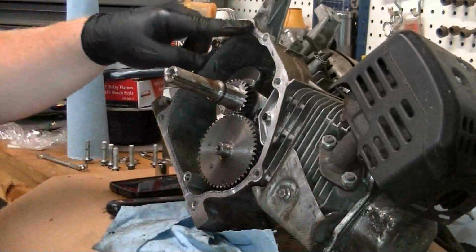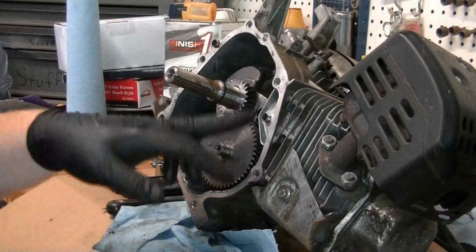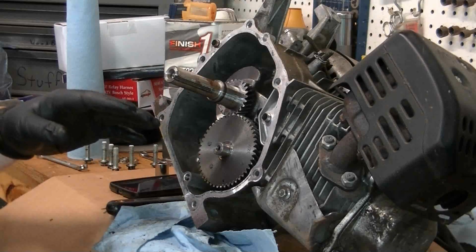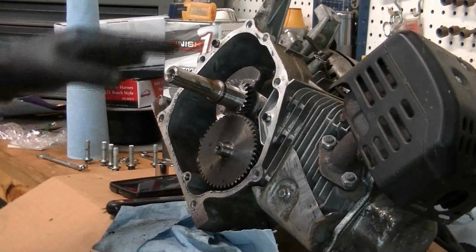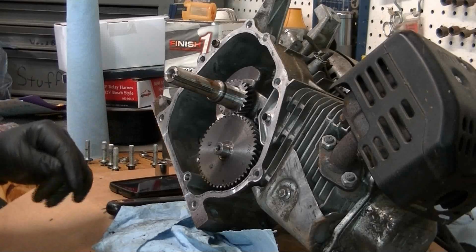Now that gasket actually came off really nice, so I should be able to use it. Again, it didn't rip any around this. I had a subscriber kind of gripe that I did that last time, and I've had no issues whatsoever with oil leakage. So as long as the gasket isn't ripped up any, you should be perfectly fine to reuse it.